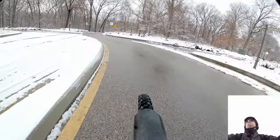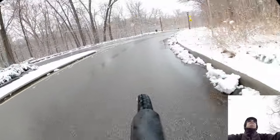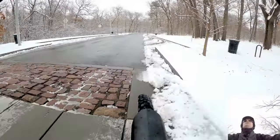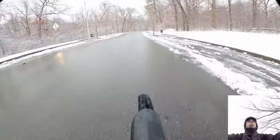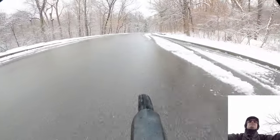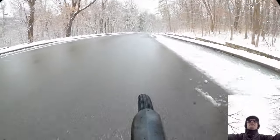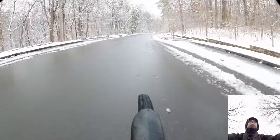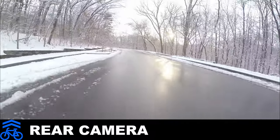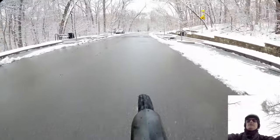It is certainly easier to shorten the reach from the handlebar to the frame without messing with your brake cables and your shifting cables. So that is obviously the way to go. However, a lot of people end up buying frame sizes that some would say are too small for them, but you can still make that work. If the frame is too big for you, there's not much you can do. So if you're unsure, it's probably better to buy one frame size down. So if you think you might be a medium or a large, maybe go with the medium.